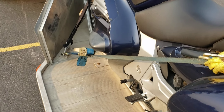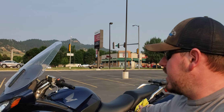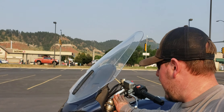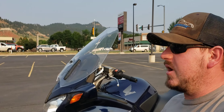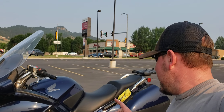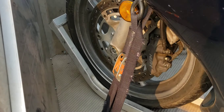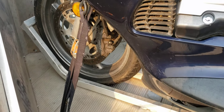This bike is very, very secure — the whole trailer moves before the bike even moves. It's a little unconventional how we strapped this one down. I'd typically go up to the bars, but because of the fairing, we used the fork legs and rear rack instead. The biggest thing I'd stress with hauling motorcycles is redundancy, and number two — keep that bike perfectly vertical and upright. This is a motorcycle-specific trailer with a front wheel chock that also helps keep the bike upright.